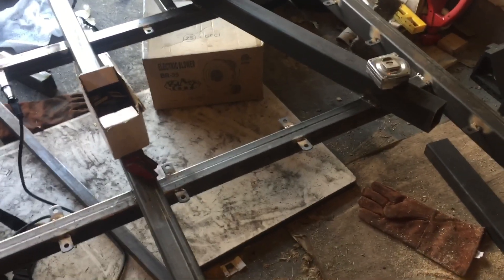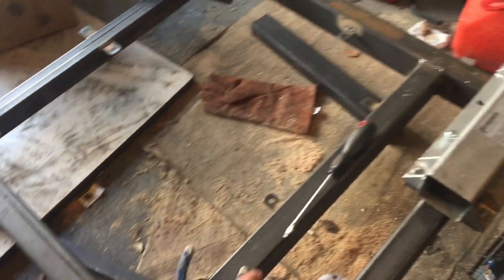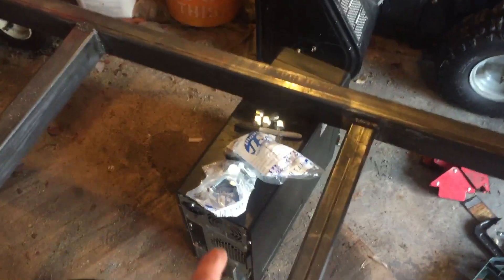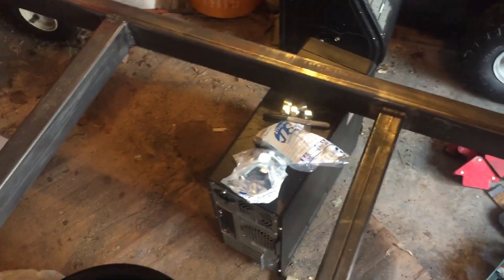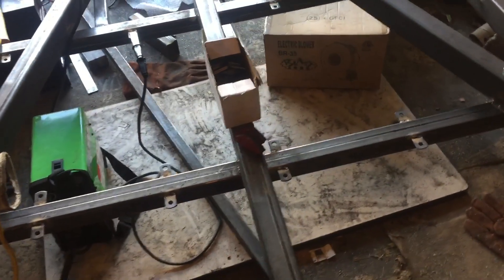The side rails are 2x3 with quarter or eighth-inch wall, and I used 2x2s on a couple of sections. I tried to maximize 24-foot steel lengths. The center axle section is 2x2 at quarter-inch — really substantial since those axles are heavy. I got the Pro Comp 15x8 wheels and bought hardware: the flexi ride takes half-inch grade 5 minimum, so that's what I got along with washers and lock nuts. Any questions, please don't hesitate — love the feedback, please subscribe and like the video!